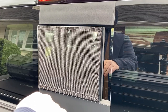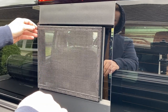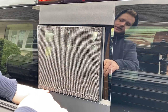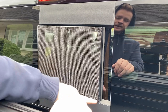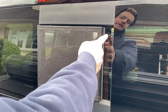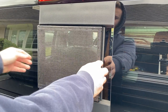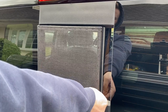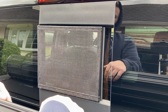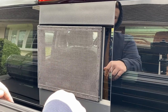Looking at this now, I can see it seals pretty perfectly. The left side is right on the glass with one foam strip on the outside and one on the inside. The top and bottom are sealing perfectly because I made it that exact height to just deflect the factory weather seal. The right side is the same thing on the sliding glass — one piece of foam on the outside and one on the inside. This thing is pretty secure, so I have no doubt it will allow for a good breeze and still keep the bugs out. It's going to be perfect for car camping.